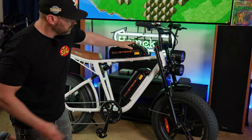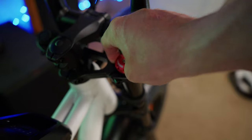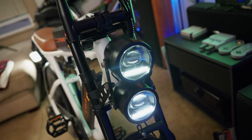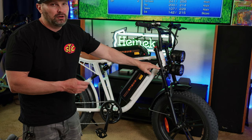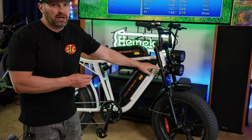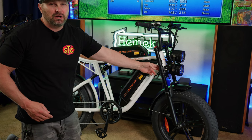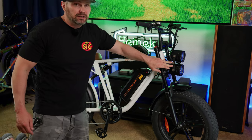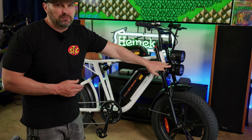It has metal fenders front and rear, and a dual crown fork in the front. This fork only offers compression adjustments on the right side. It has a cool dual headlight setup. One thing I want to point out — I heard a few people say they had a difficult time putting the headlight on due to the bracket. A pro tip: you can disconnect the headlights from the bracket before you install it onto the bike to make it easier.